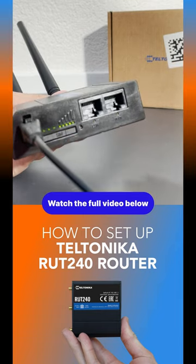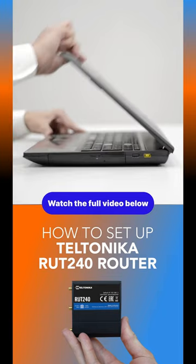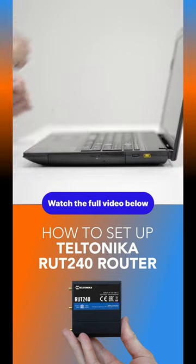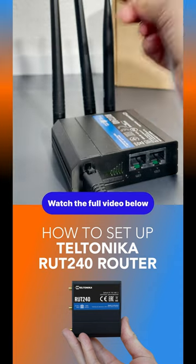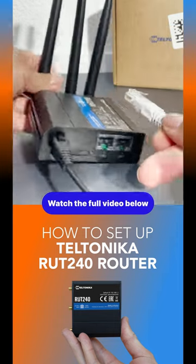The next piece is to connect your device wirelessly. One, turn on your computer, select the wireless network RUT240 from the list, and click connect. Two, enter the Wi-Fi password located on the device's label, or use an Ethernet cable connected to the LAN port.